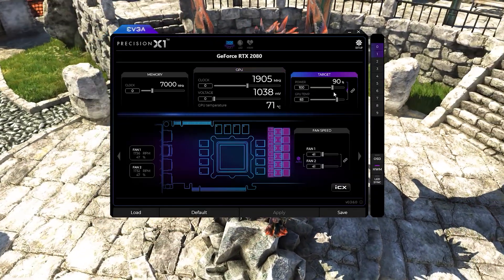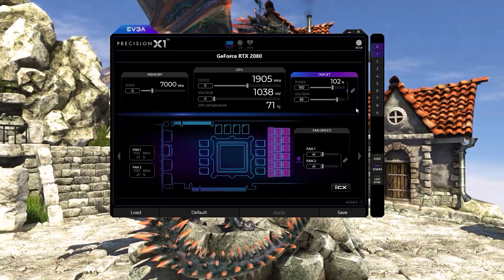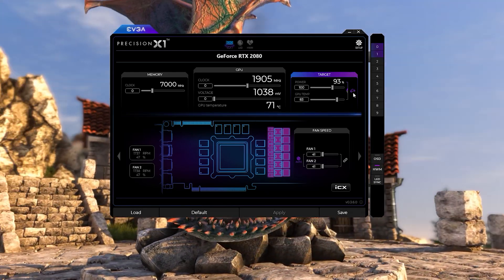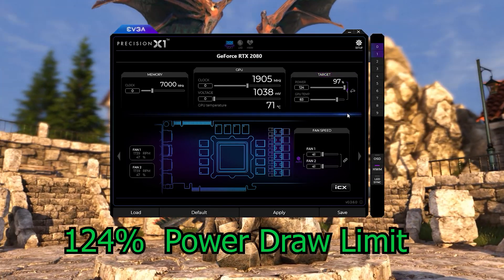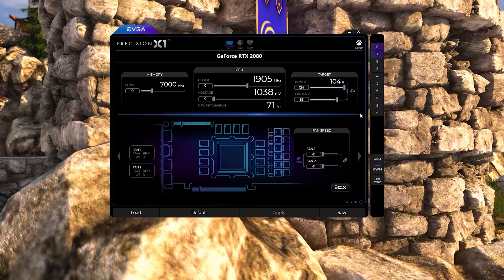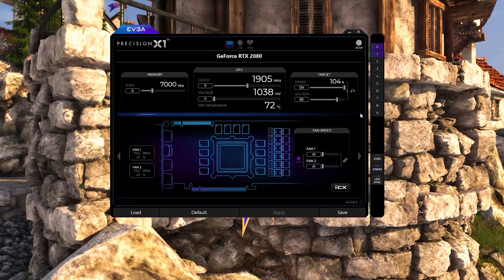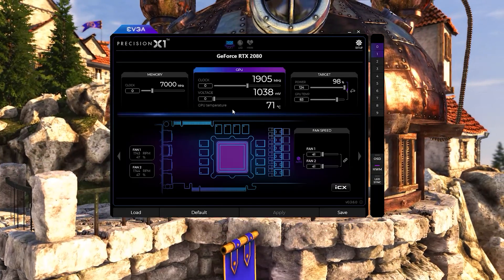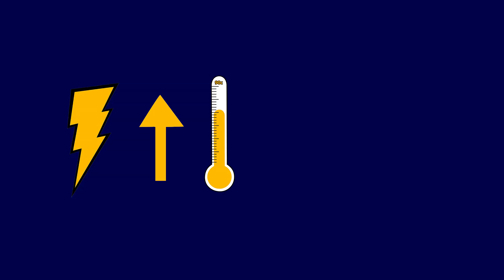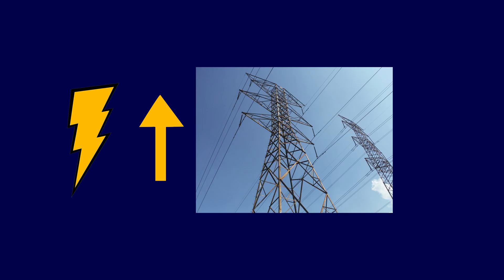As you can see, when running a benchmark or your game, as temperature increases, frequency lowers. As your power draw increases, the voltage increases and there is a limit. For the Founders Edition cards, 124% is the maximum power draw, which limits how much voltage can be drawn and therefore limits how much frequency is allowed above the base limit. So as long as you keep those three factors in consideration, that is the fundamentals of Boost. As your voltage increases, your heat increases and therefore your clocks lower. As your voltage increases, your power draw increases, and then you hit the limit and your clock speed can't go higher because the voltage limit has been hit.